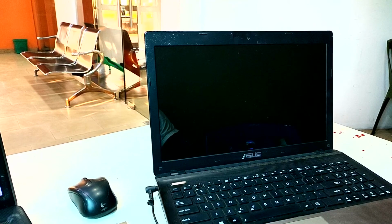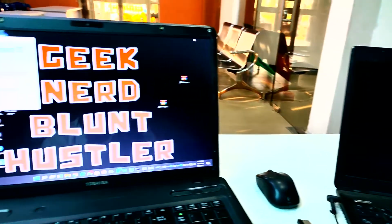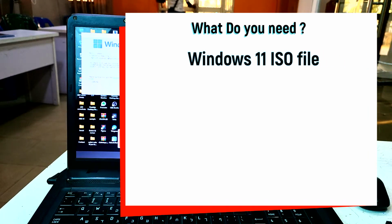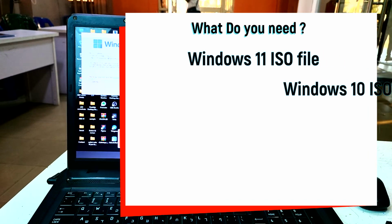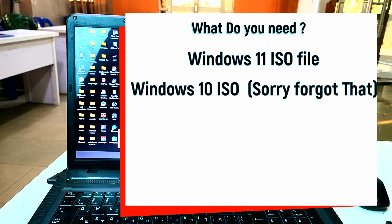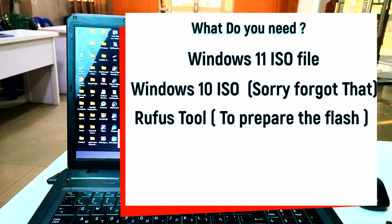I'm going to go through the most important things you need before you actually begin to install Windows 11 on your system. You need 5 major things. First off, you're going to need the Windows 11 ISO, which is here, and I'm going to leave the link to this ISO in the description below as well. Then you're going to need Rufus, to prepare your flash drive for the installation of Windows 11 on your system.